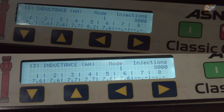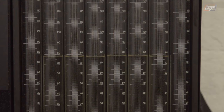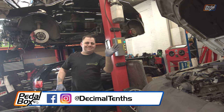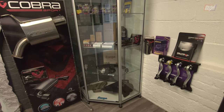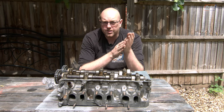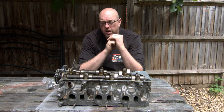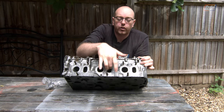After cleaning, the inductance across all six injectors is looking much more even, so the flow should be a lot more even also. From the flow test we can see the difference between each one is now closer to one percent than the two and a half percent it was before. Thanks very much to Nick and all the guys at Decimal Tenths - Callum and Colin - who helped us get the head sorted and do all the injector testing. The injectors had a little bit of discrepancy across the flow and the pattern looked reasonably good on the tester, but now they've all been cleaned they are looking way better and flow nominally exactly the same across all six.